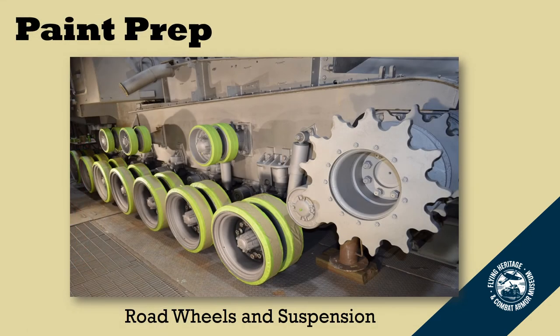Here I'll explain what we did with the road wheels and hubs. The hub assemblies, the backsides of the road wheels, and the wheel face where the lug nuts go were primed and painted prior to remounting them — which is where they are in this picture. The reason is that you simply could not access the backsides of the road wheels and hubs after mounting, and since we had sandblasted all those surfaces we wanted to make sure we got primer and paint on them to prevent any further corrosion.